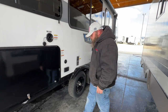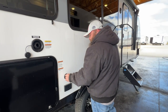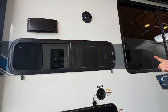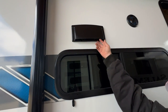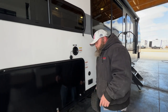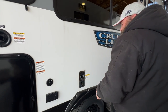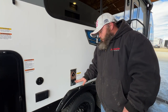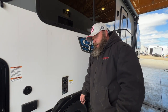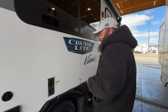This is so you can bring a TV outside and hook up to it — you've got a GFCI-protected 110 outlet. Your vent for the stove is right there — always pop this open when you're cooking and keep it closed when you're not. During travel, keep mud daubers out of there. Also, try not to block this furnace vent — I recommend getting mud dauber screens, they look like a couple of eyeballs and go right over the front of these. They help keep wasps and mud daubers from building nests that can cause the furnace not to operate properly.